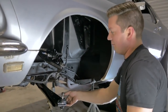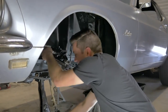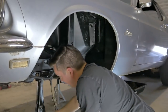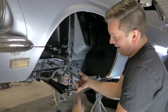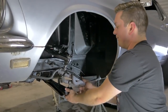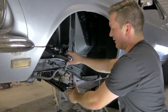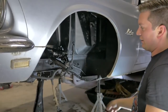We're going to leave this one fairly loose — this is the only one you really need to worry about leaving loose. These guys are kind of self-contained; they're not going to bind, they'll go up and down. This comes pre-tightened on top but you want to get the weight on the car before you fully tighten it down. I'll rotate the cam to where I want it to get a basic alignment for the camber — realistically I'll kick it out as far as it can go because more camber is better to an extent. We're not stancing this thing. Leave this one loose for now; once we set it down I'll give it a final tighten.